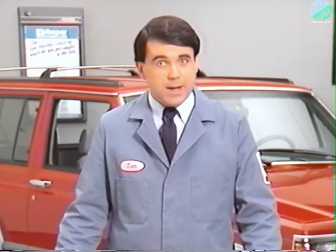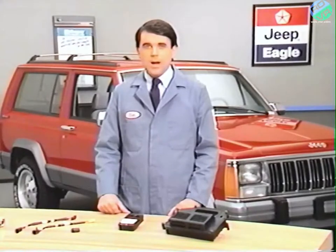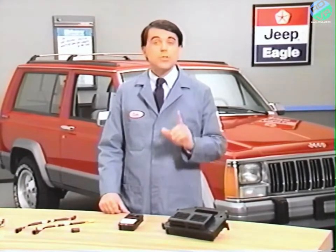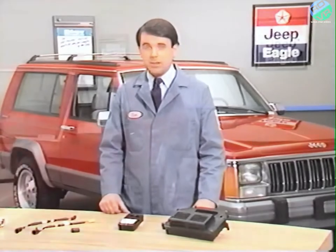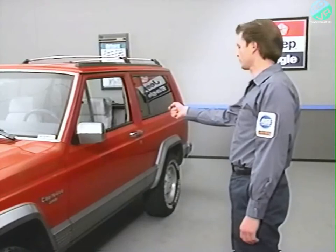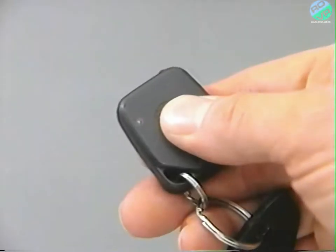Failure of the horn to sound indicates a problem with the switch, wiring, or SAM output providing the path to ground. Operation of the power door and liftgate locks with the keyless entry system should also result in the horn sounding. Remember to allow a 1-second delay between locking and unlocking.